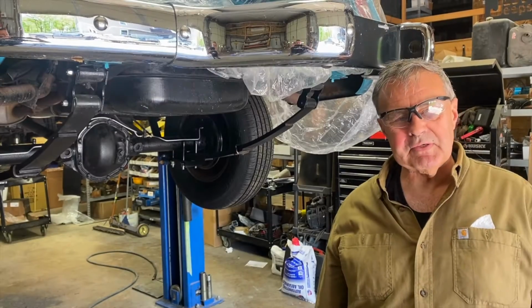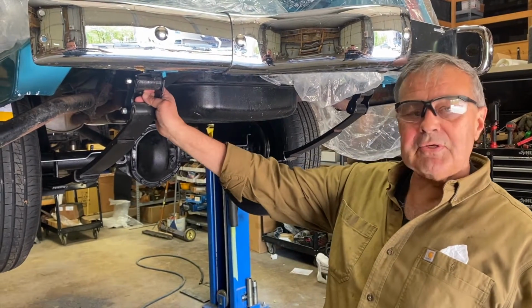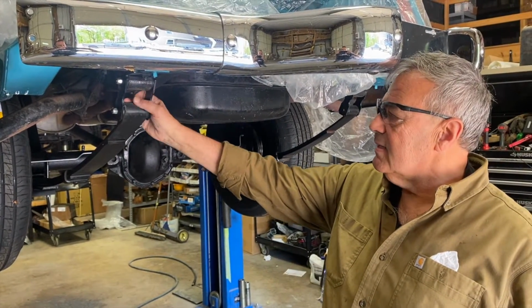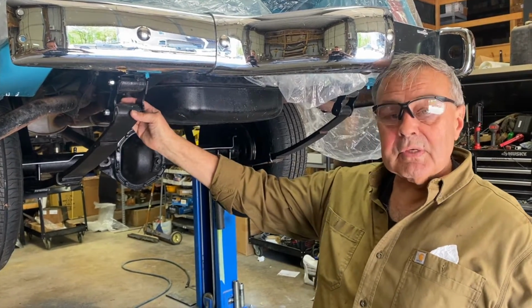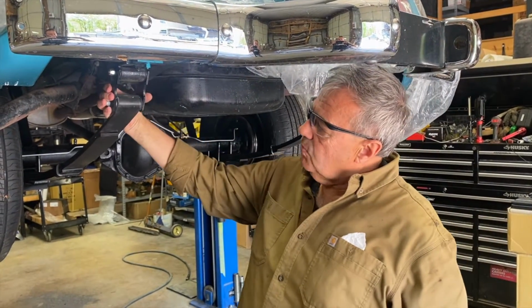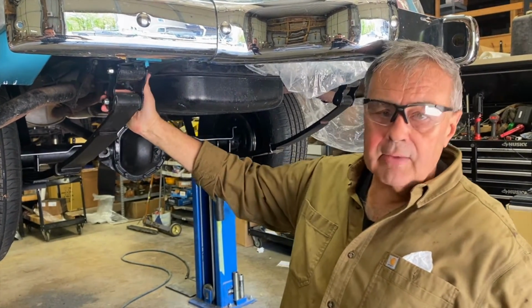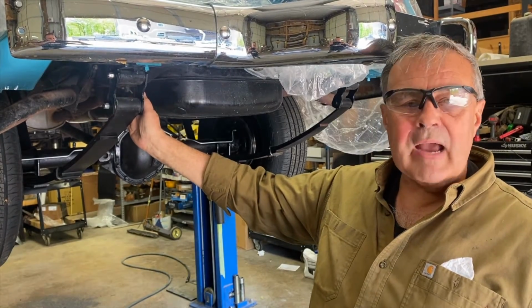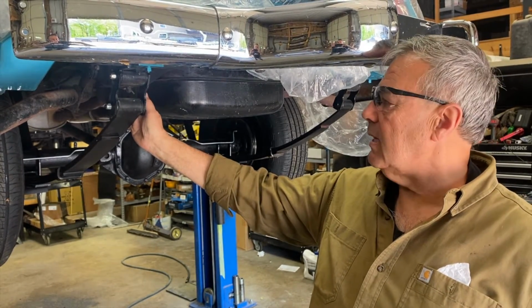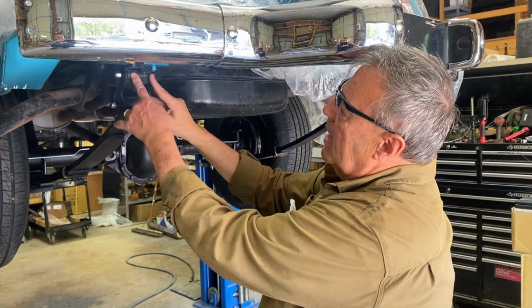This is Mark from the JeepsteMan. Today I want to talk a little bit about these rear shackle bushings. And this is a kit that we sell. And you can see there's an upper and a lower set of bushings that go in this kit. This is a 2.5 inch wide shackle. Very common, they wear out, and they should wear out. They're actually meant to absorb a lot of the road vibration, road shocks, bumps, driving characteristics of your vehicle. So these bushings right in here will wear over time.